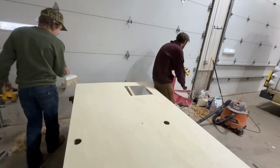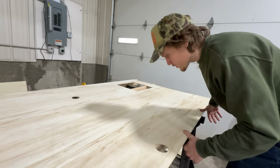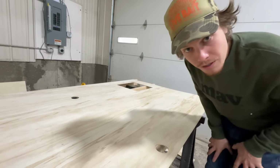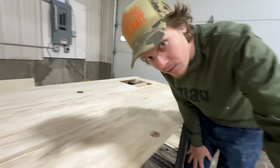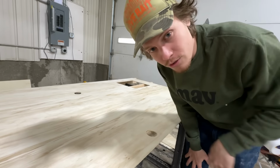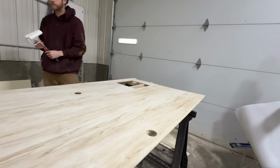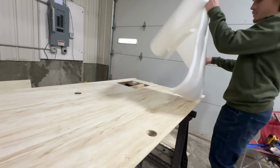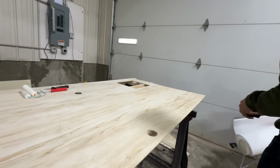If we're up, I'll go grab us some foam. All right, so this is one of our roof panels. We are going to be putting some foam on it to add some insulation, also some padding to where the tapestry is going on. So we're gonna spray glue that down, and we're gonna try to mount this thing to the roof. You wanna start at one end, I'll start at the other? Yes, sir. On the spray. Yep.